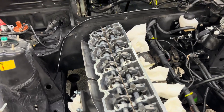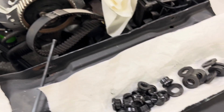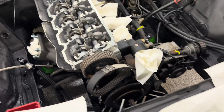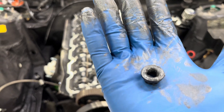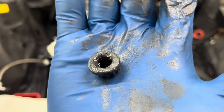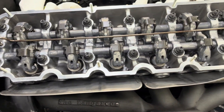I have the head on now. The next thing you're going to want to do is use the fastener assembly lubricant supplied to put some lubricant around all the threads at all the head studs. Then as per the instructions, you're going to want to lubricate the inside of the nuts and put some on the washers as well, then install them. Just a little bit of lubricant on the face, rub in the first couple of threads with your finger, and rub lubricant on the washers. I've got all of these just snugged up now.